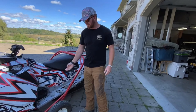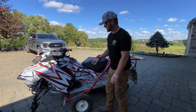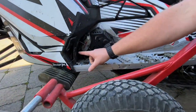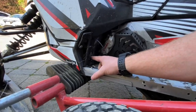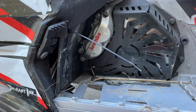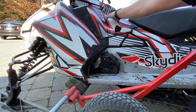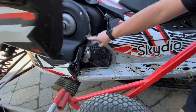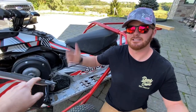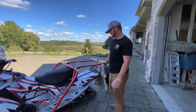A lot of the water clings off the back of the ski, especially when you're carving, and it comes up, splashes against stuff. So I just took a piece of plastic, it's actually an old car fender from the inside, and just took a heat gun. Sorry, the sled's super dirty right now, but because the belt is right here, water basically shoots up and it's like freaking ice on your belt. It just throws it neutral real fast. So cover up your belt hole.